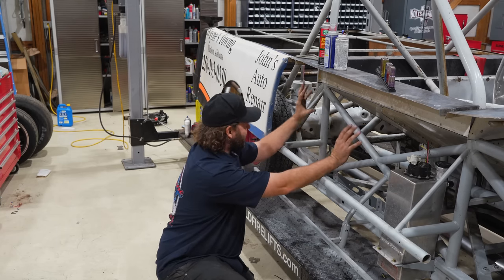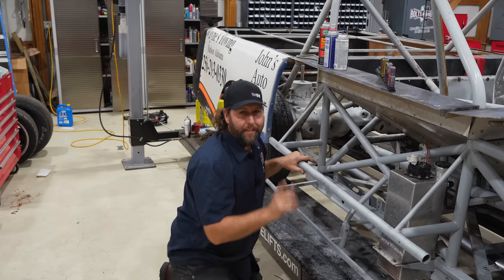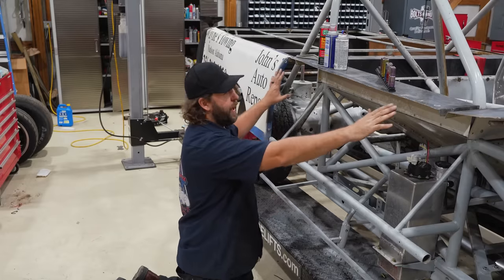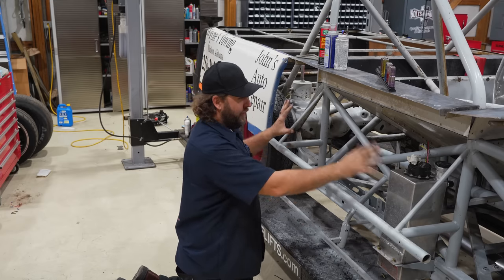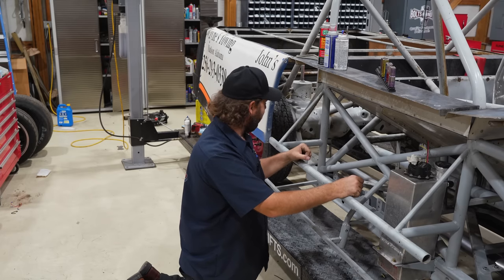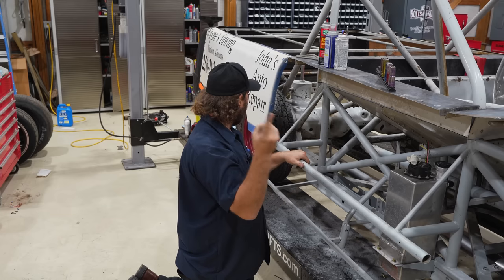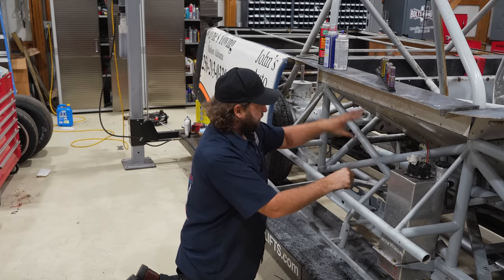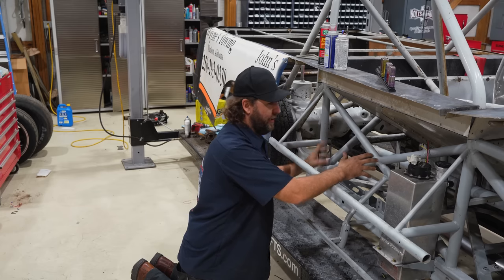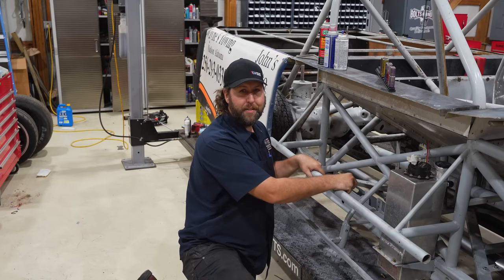I need a plate in here because I'm going to be putting all the relays, doodads, and boxes in here. My thought is, if I were to pop the side off, you'd have everything here — fuel pump, all the digitals, all that stuff. So we're not clamoring and climbing around. It just makes sense to have everything centrally located and put all the weight on this side of the vehicle. I want it to be modular — something we can put in and out for serviceability. If we want to take the whole plate off and take all our electronics with us, we can.